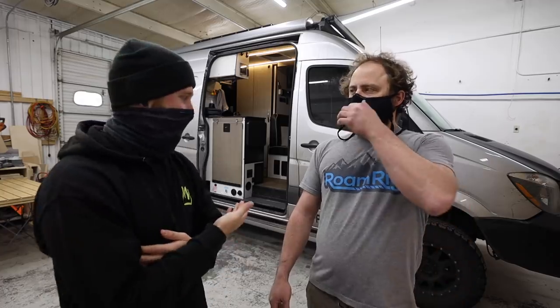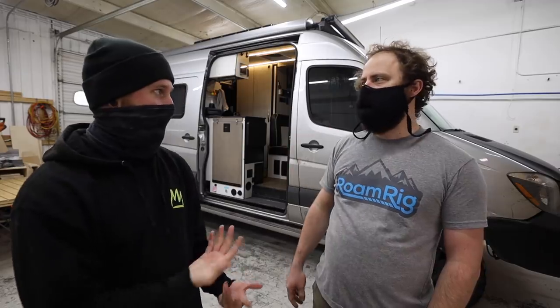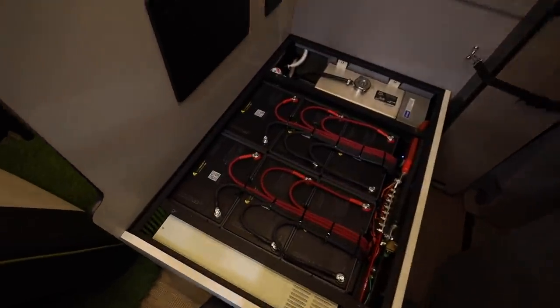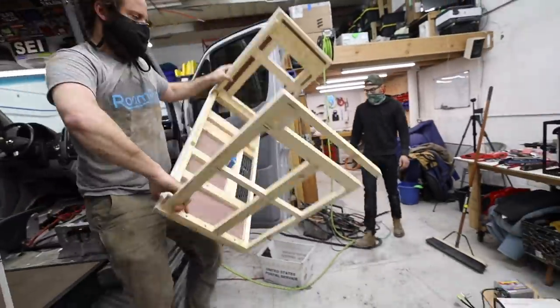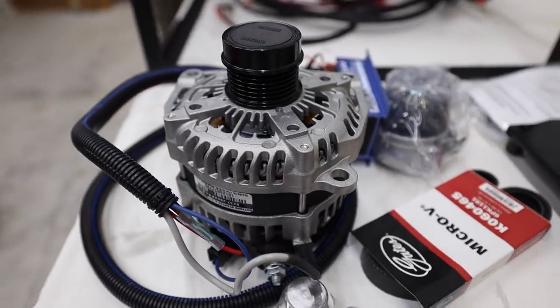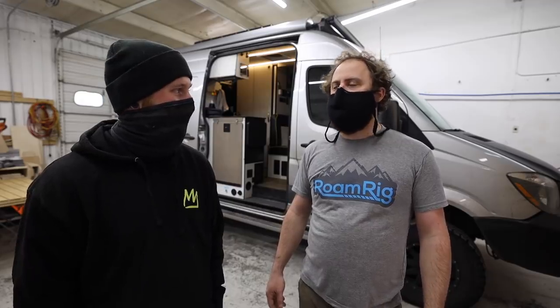To put that into perspective, I've had my AGM batteries for almost two years now. I am pretty much full-time and they're basically dead, really close to dying completely. You'll get more usable power out of a lithium battery. I also centralize all the components inside the van underneath the bench seat. The stock system kind of has batteries and wires and components all over the place — everything comes out. It's 354 pounds of stuff that comes out, then it all gets replaced with a centralized system. He's also getting a second alternator so he can charge really quickly. He's going to have 630 amp hours of storage, and if that's fully empty, roughly three hours of driving and it will be fully charged.